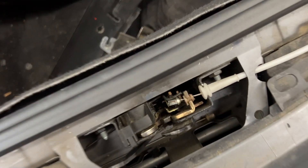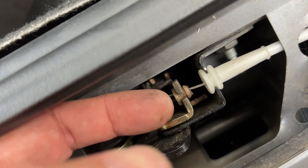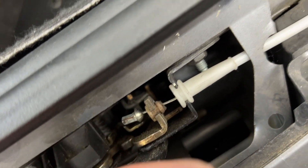While we're in here, just to show you guys — if we did need to replace this cable, if you pull that and nothing is happening, you just slide this piece up, and then there is this little rubber grommet. You pull it through this side, and this piece runs right back here. There's a piece of foam with a rubber band around it that's glued onto the end — you just take that foam off, put it onto your new piece, and wedge it right back there in the same spot. There's a little electrical connection — you just unplug, plug it back into your new one, stick it right back in there, and you're good to go.